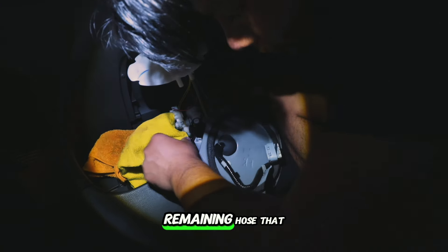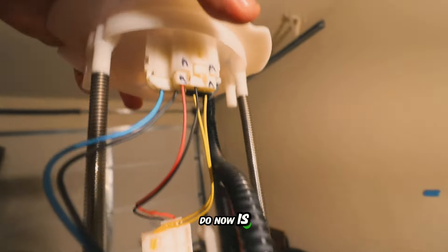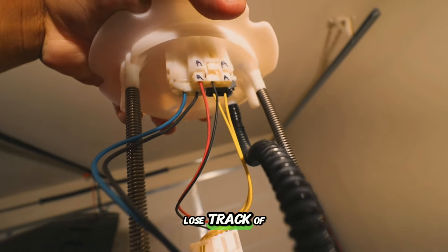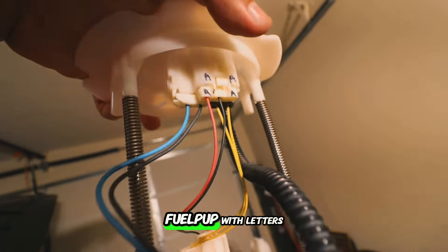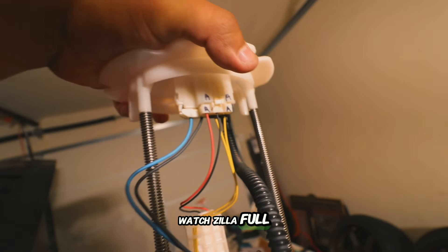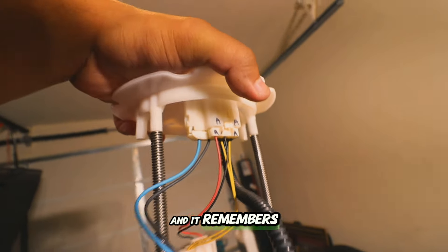Be careful — there are a lot of wires, a lot of hoses, and the edges where the fuel pump is coming out are kind of sharp, so just be careful, wiggle it around, and take your time. I found it easy to squeeze the fuel pump with both hands, squeezing these plastic parts a little bit so they can fit within the circle. Now unplug these plugs, and so you don't lose track of which one goes where, mark them — we're putting A, B, C labels on them.